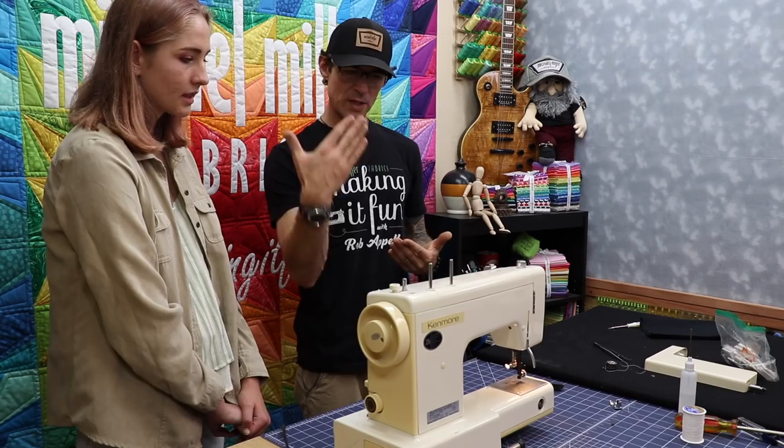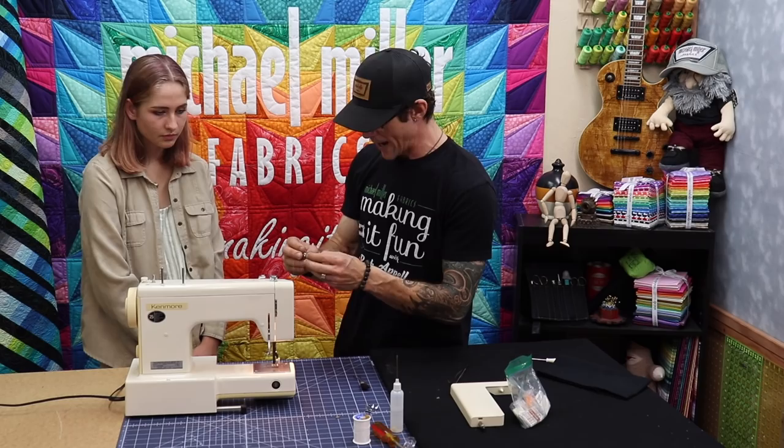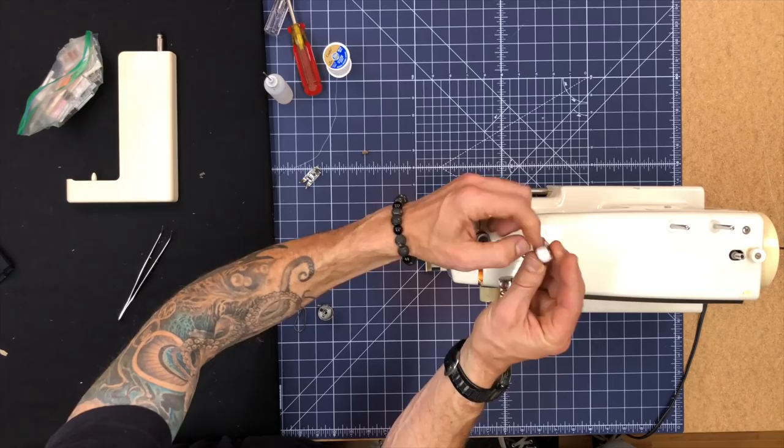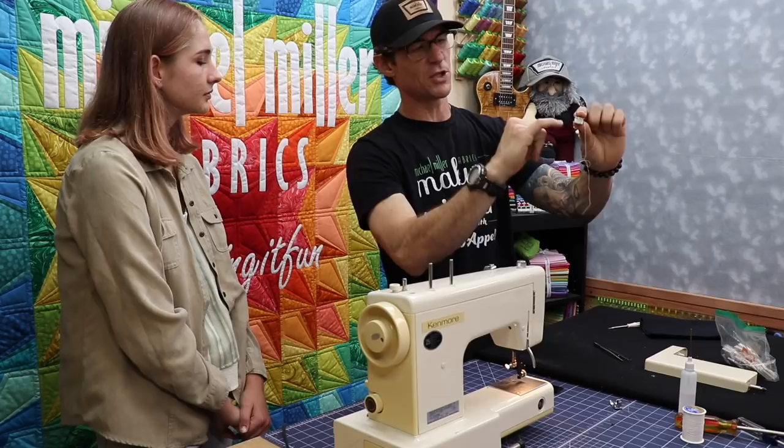We still want to see if it's going to form a stitch. Let me check your thread because you do have a wound bobbin. This was you. This was white. You've already confessed to being the white thread. Okay. So it looks pretty good. It's not too spongy. It's not too gooey. If I pulled on this thread and like half of it shifted over to the side like an old set of tires or something like in the Michelin ad, that would be a bad thing. So right now this looks pretty good.